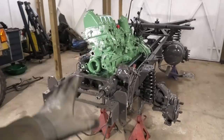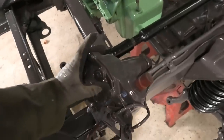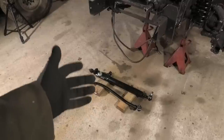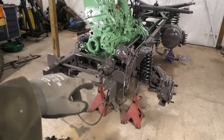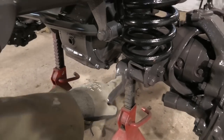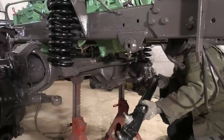Power steering was an optional extra, but on newer or bigger vehicles it would be built directly into the steering gear. That's also the case for newer Unimogs, but that also means the whole unit becomes much bigger and there's already not a whole lot of room in this corner on these Unimogs. So that's probably one of the reasons they went with this option, which was actually a fairly common way to do aftermarket power steering on things like this and also tractors that already had a hydraulic system you could hook into. Really the only structural thing you had to change to fit a kit like this was that you needed another mounting point - a solid point somewhere on the axle to function as the anchoring point for one end of that hydraulic cylinder.